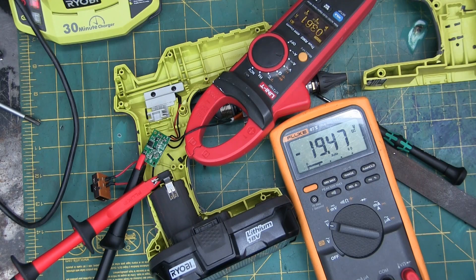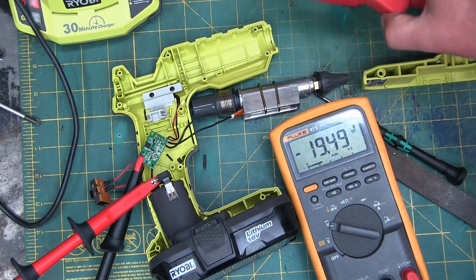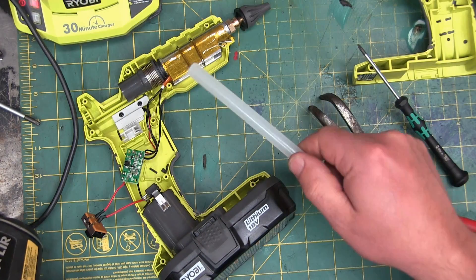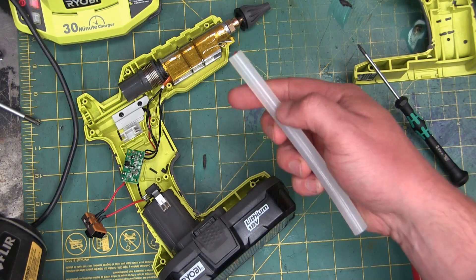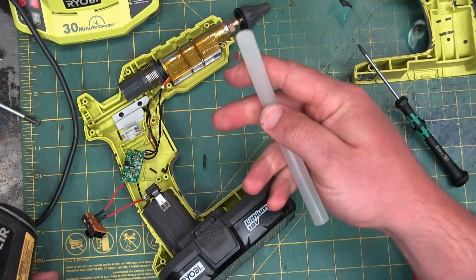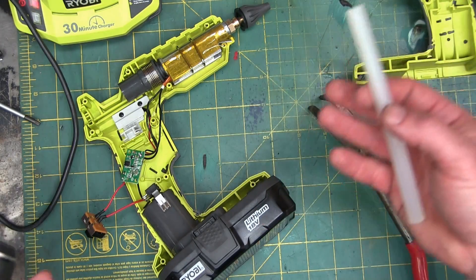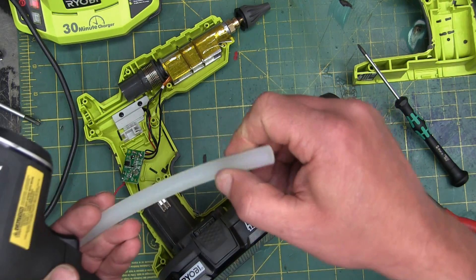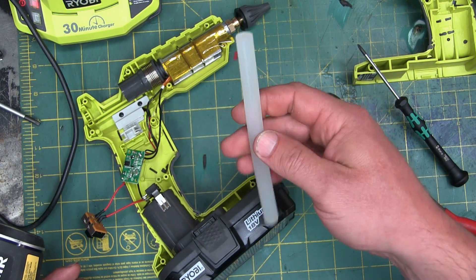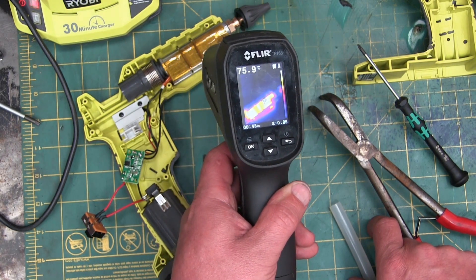Let's get her back together. The wattage is one thing, but the ultimate temperature is another — we want to know if we can only do ethylene vinyl acetate, this stuff. It's only usable up to maybe 50 degrees C. There are a whole bunch of other industrial glue sticks, totally different formulations — how many flavors of Kool-Aid are there? These ones are the cheapest with a half-decent glass transition temperature so they don't get brittle in the cold. I want to see what the ultimate temperature this rises to.